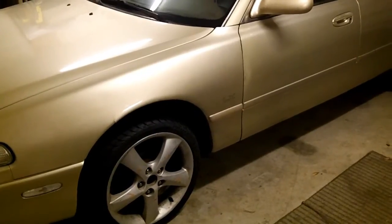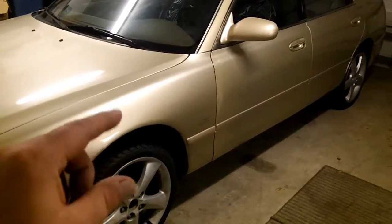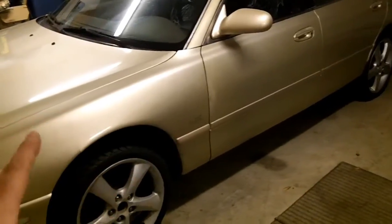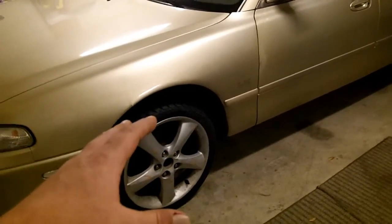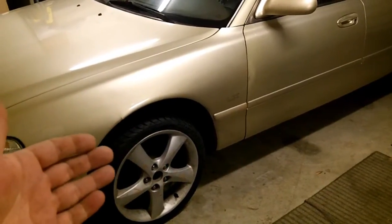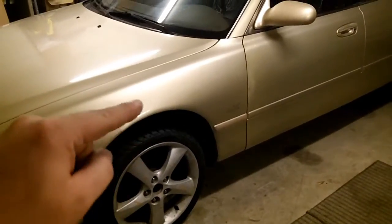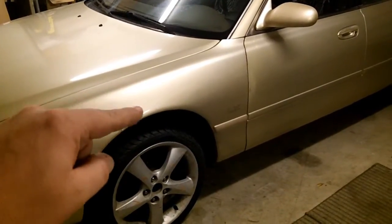And I really like the way that these looked on PrinceValorum's car, and PrinceValorum knows that. He helped me a lot in making sure that I got the right tires on here so that I wouldn't have to get spacers. And if you get a bigger tire, like a 215/45 or a 215/50, you're definitely going to want spacers. You're going to have to bring those out, just like ND28s. If you haven't seen ND28's video on his spacers, you're going to have to use spacers to bring those out so they don't rub up against the side or the top of the strut tower.